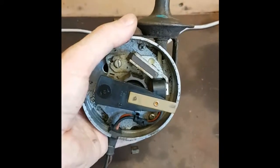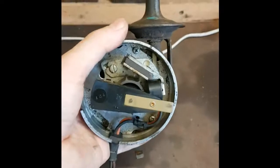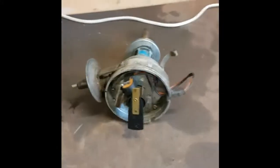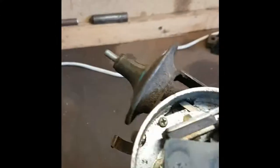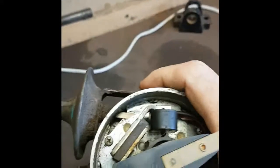This distributor has been fine until recently — I've just had a spate of issues one after the other. When you rev the motor the advance jumps right around, the engine backfires, and it's really undriveable. I put a little pump onto the vacuum advance the other day and that mechanism seems to do what it's supposed to.